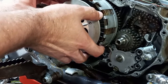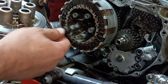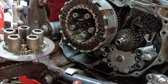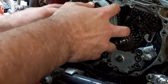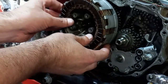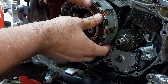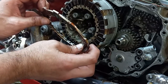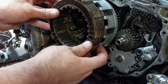Pull the pressure plate off — comes out like that. The next piece that comes out is this; I think it's called the clutch engagement pin. When I take something apart, I put it back together the same exact way it came off, especially if it's something new to you — keep everything in order as you take it apart. After that, the next things to come out are the fibers and the steels. Notice that these are all seated on the same inside teeth all the way. Some quads are different, so just pay attention to how you take them apart so they go back the same way.